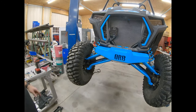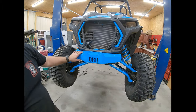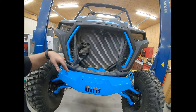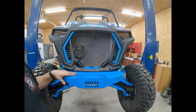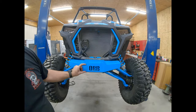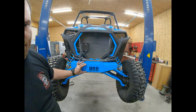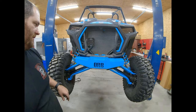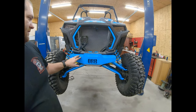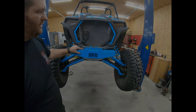After you get the bumper on there, you can still get around the back side of it to put a winch on — it's a little tight but it's very doable. Same thing, the grill comes in and out. You can always add our upper bumper later. Another option we offer is two clevis mounts that weld on to the front — two D-rings — so you have somewhere to pull from or to snatch block from. That's about the gist of it; it's a pretty simple install, probably struggled more with this one than I normally do, but that's what happens when you're on camera.